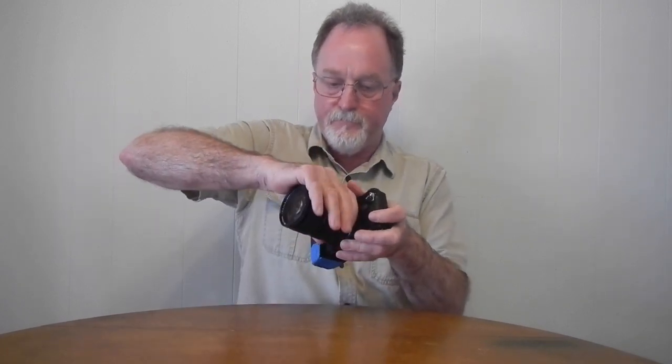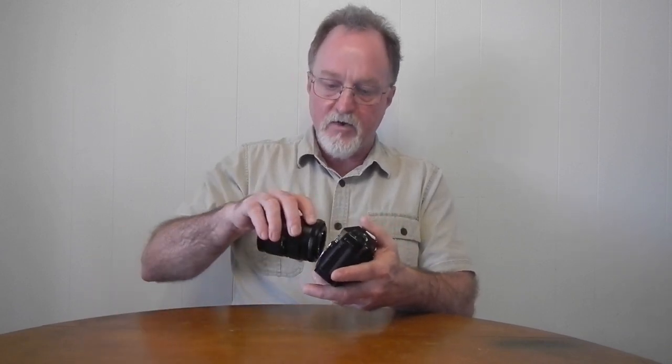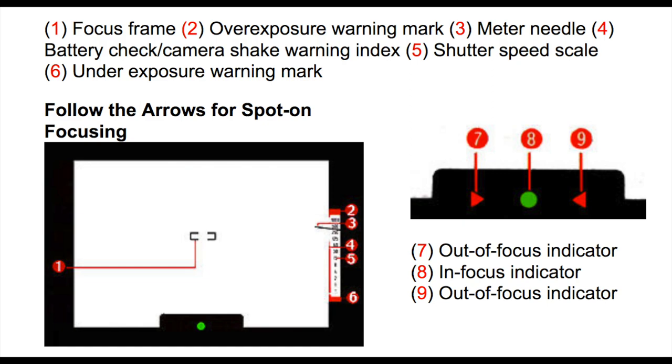This is an early endeavor into research on autofocus. It's not an autofocus camera, but it has marks on the mirror — I'll get a still so you can actually see that — so light can pass through it and go to a charge-coupled phase detection array at the bottom of the mirror box. When the phase matches, it's in focus. It has red arrows in the viewfinder showing which direction you need to move your focus, and when you've got focus, there's a green dot at the bottom of the viewfinder. It's not a super high-spec camera, but it's not horrible either.